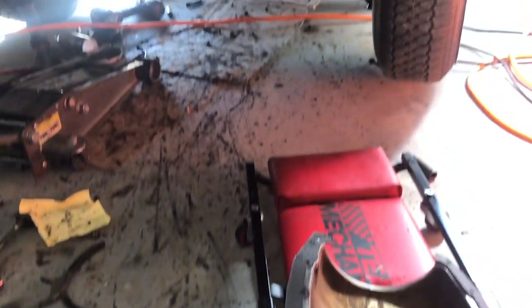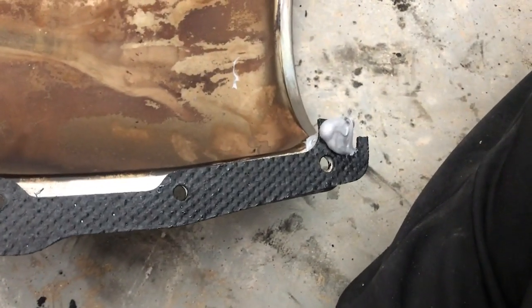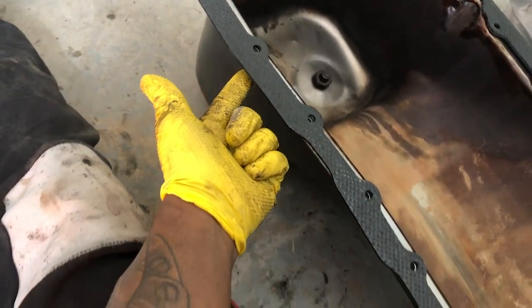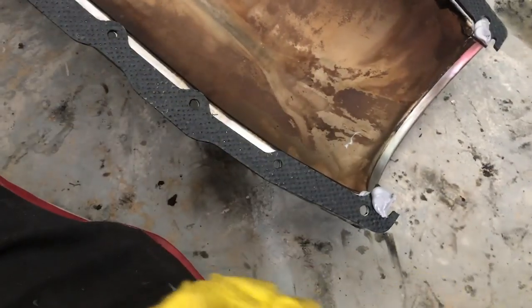I put a little too much oil so I had to wipe it off in the corners so the RTV could actually stick. I'm about to clean up under there one more time, jack the motor up, and put it on. I added extra RTV to the pan — squeezed it all out in the corners. Don't be cheap with the RTV, because if you are, you'll be doing it over. If you're already at this point, make sure you do it right. I'm about to shove it in, get a couple bolts in, let the motor down, get all these parts back on.